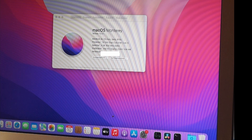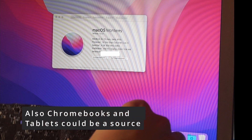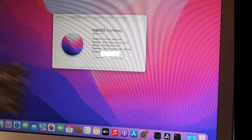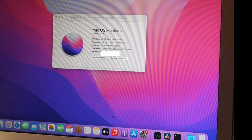The other way is from a donor main board — that's what I did here. This is a 2015 MacBook Air with a broken processor; it won't work again. But it's still very useful as a parts donor because it was an 8GB model, and I harvested the chips to put into this machine.